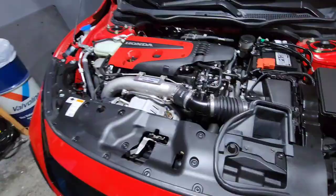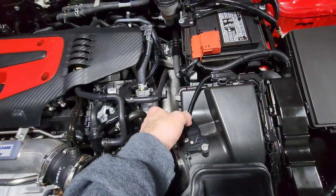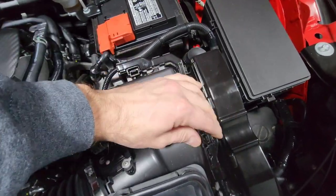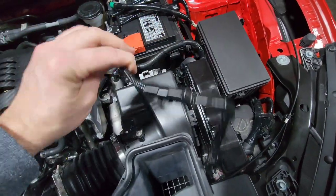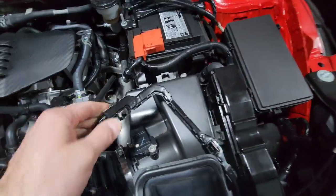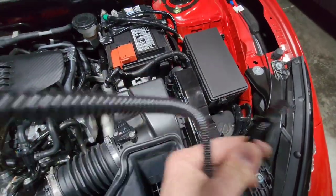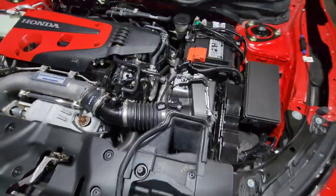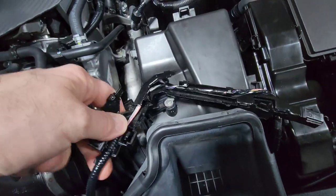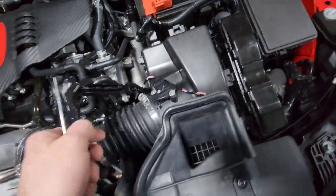You're going to have to pull this up — there are two 10mm bolts here you have to take out. You're going to have to unplug your MAF, and there's a wiring harness which you just pull on those tabs. This has got a plastic bit all the way around it which it looks like unclips, and that's where this loom goes — you put that in place so it doesn't look so terrible. Get a little flat blade in those clips, pop all that off, and pull that off — now you've got all that bare wire to put the loom on.